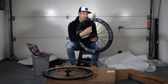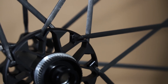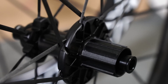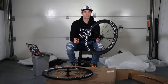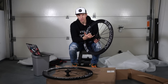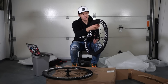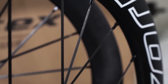The spokes are quite wide and very aerodynamic. The nipples are different too: at the side of the hub there's a square ending which locks into the hub, preventing the spoke from turning. On other aerodynamic spoked wheels I've used, the round nipple allows the spoke to rotate freely, which changes both spoke tension and aerodynamics. This system prevents that.